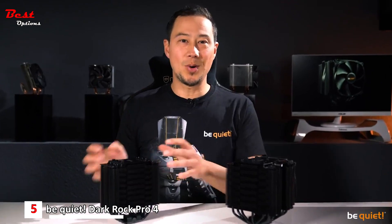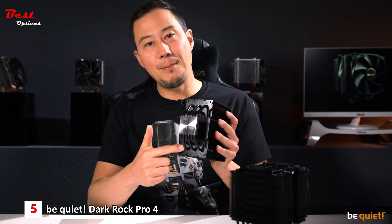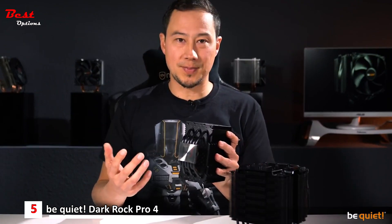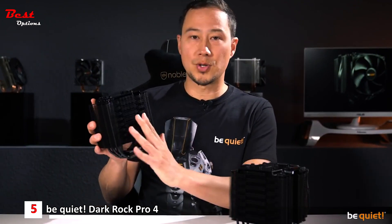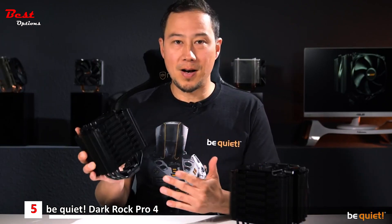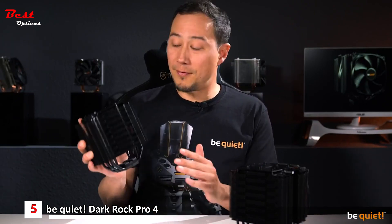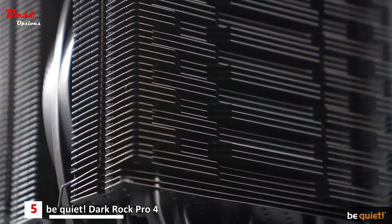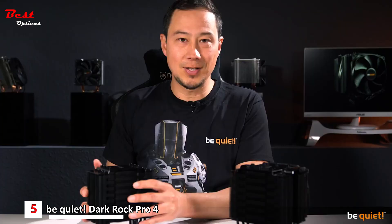Let's go into the details. The new cooler fins are embossed throughout in order to increase the cooling surface. At the same time they are wave contoured, which again is not just for the looks. We tried a number of shapes and layouts until we finally developed this form that uses air swirlings for additional cooling while minimizing noise emission.